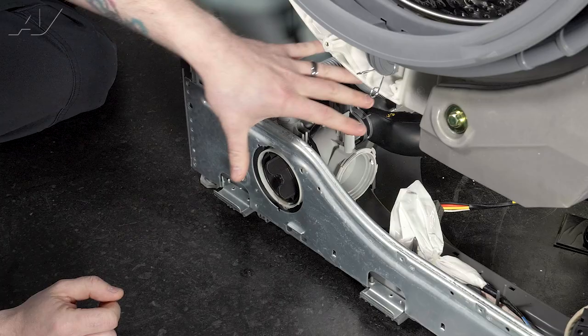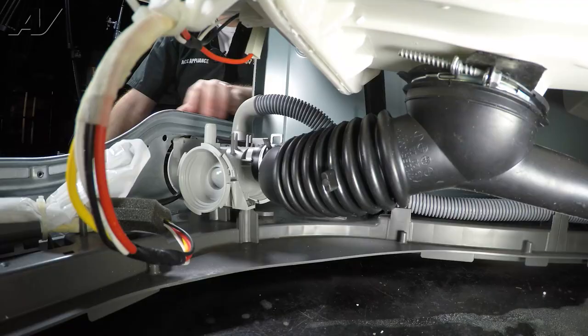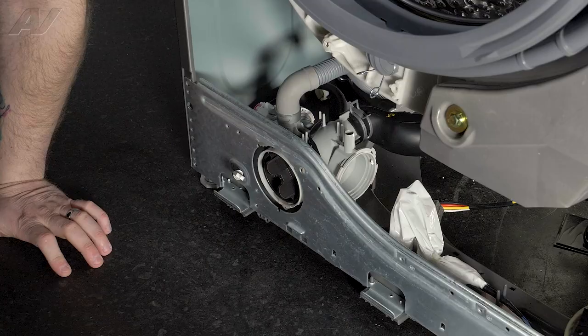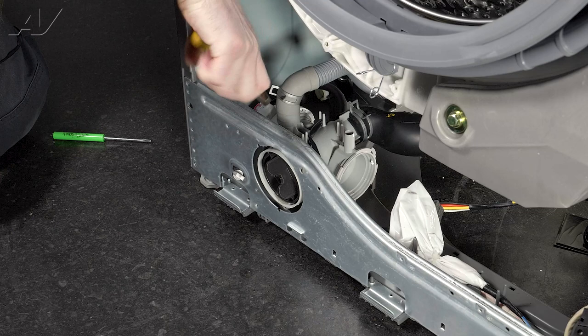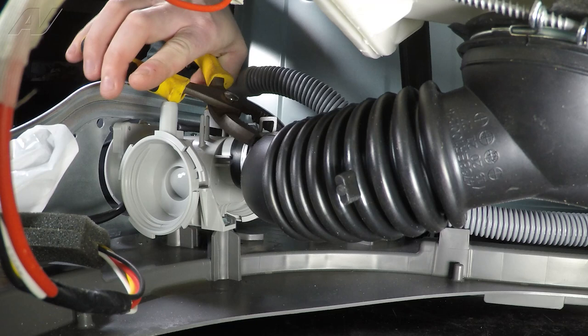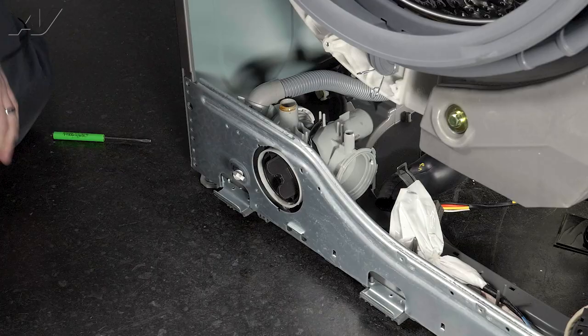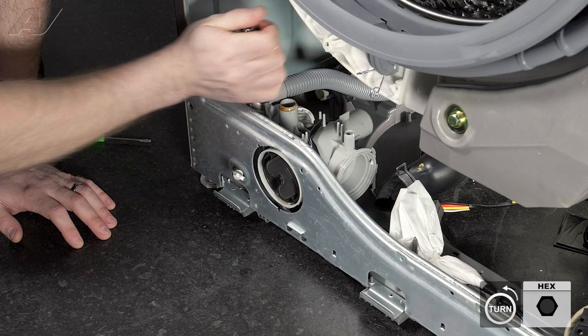In order to replace the drain pump, there are a couple of things we'll need to do. We have two 5/16ths screws in the front and back, as well as taking the hose clamps off. Starting with the clamps, use a pair of pliers. Start with the drain line first, then pull the tub-to-pump hose off. Pull the clamp back and separate it. Now we can get inside and remove the screws — you can use either a Phillips or a 5/16ths, but since they're kind of stiff, the 5/16ths is recommended.